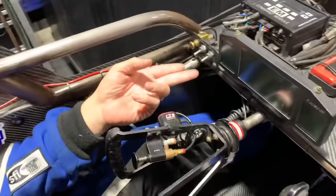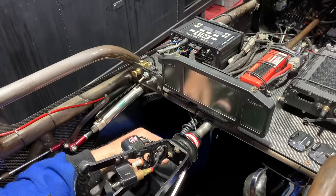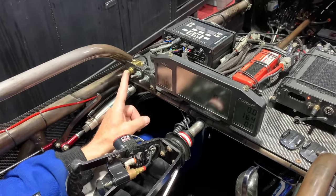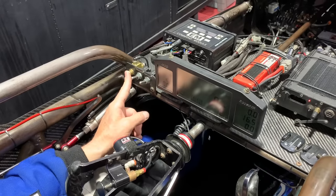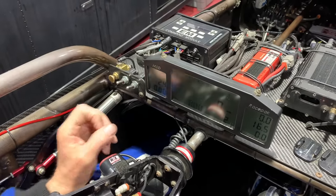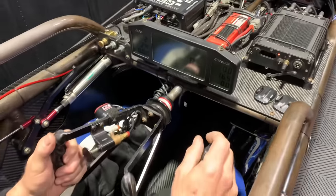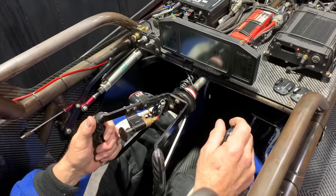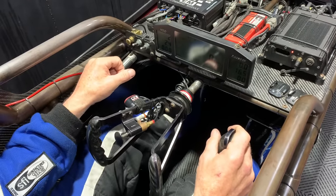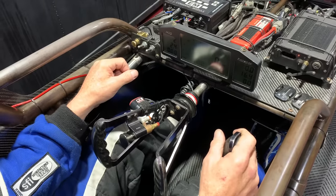The crew chief will then reach in and tell me to flip the switches on. This is the ignition switch, this is the race pack data system switch, and this loads the clutch system. I'll turn those switches on, push this button, typically count to about three, and when I let off you'll hear a little pshh of the air system being charged. Holding the brake, clutch pedal in, no throttle — none whatsoever. And I will wait until I hear the car start on gasoline. We actually start these cars on 87 octane cheap gas.